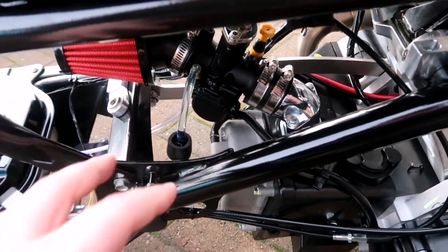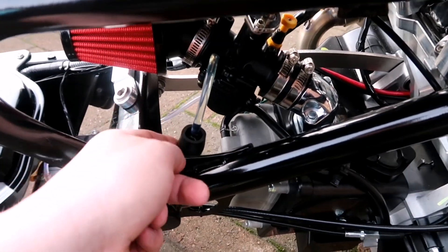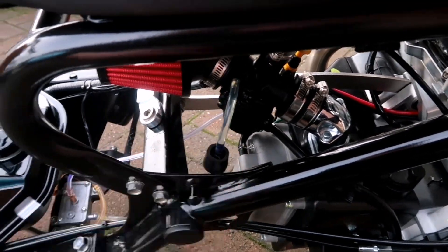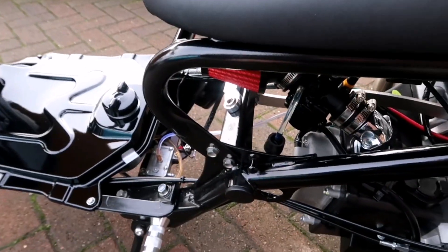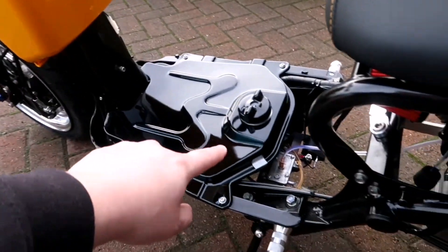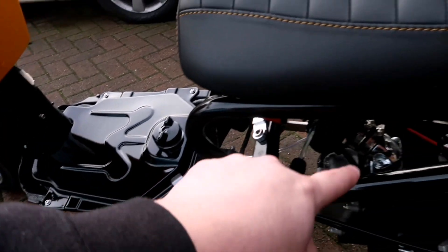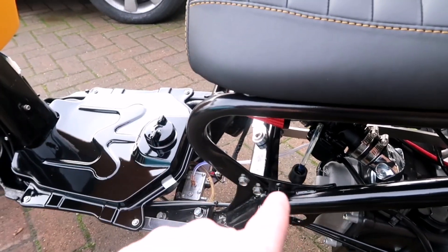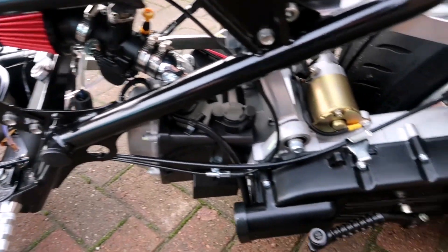Because she wanted reliability, I've put a one-way valve in to keep the fuel up. As you may know, when you crank a GY6 over it takes a little while for the fuel to go up the line and into the carb, and you can actually run your battery out in that time — so that little measure really aids reliability.